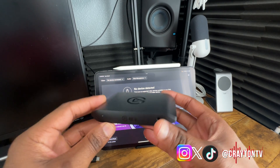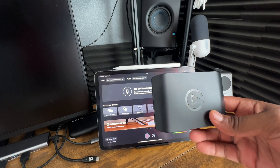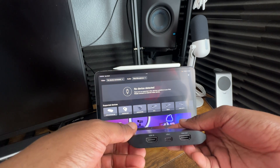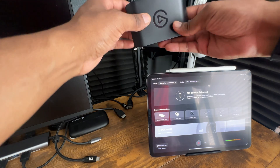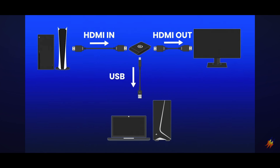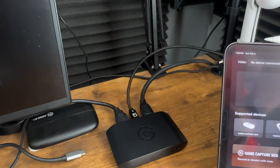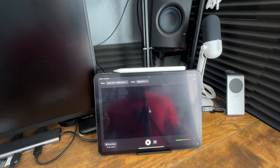The setup process is really simple. If you want to use the Elgato 4KX Capture card, you take your console's HDMI port and plug that into the HDMI In port on the capture card. Then take the USB-C and plug that into your iPad. The other port goes from your monitor to the HDMI Out port. So HDMI In from the console, HDMI Out to the monitor, and the USB-C cable — I'm using the Godspin USB-C cable, link in the description — plugged into the iPad's USB-C port. It should connect and show input.